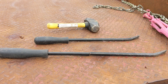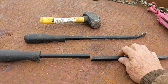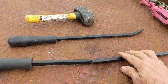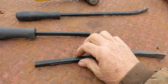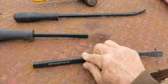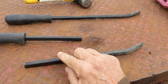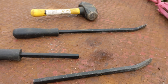This is the tool I made. I keep this in Stevie, the 1974 Crown. What I did is I just cut off one of the Pittsburgh pry bar set pieces because it's narrow enough to fit into the opening between this cross pipe and into the clutch adjustment area, and it's the right length. Everything else I had — all the punches and chisels — were just a little too short. So this stays in the bus.